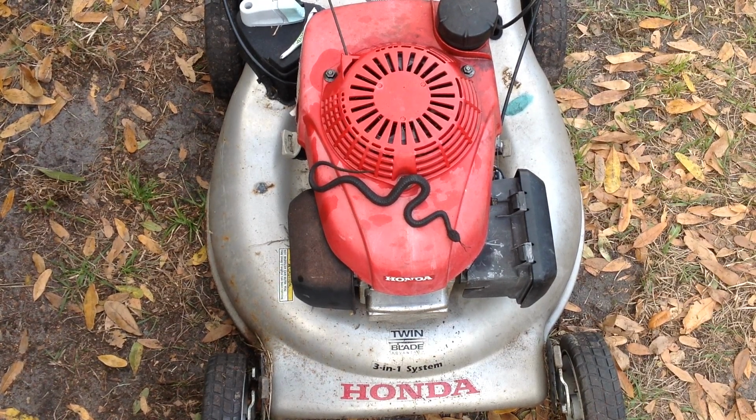And then we tried a little Happy Juice yesterday, and I had mentioned that it seemed to be pulling over easy. We did not get any action out of it at that point, so I went ahead and took the valve cover off and noticed the intake was not closing. It was stuck in the open position.